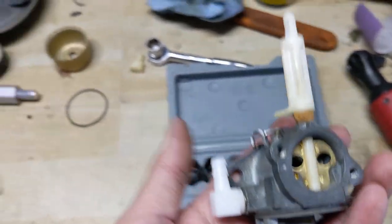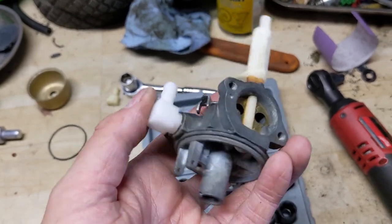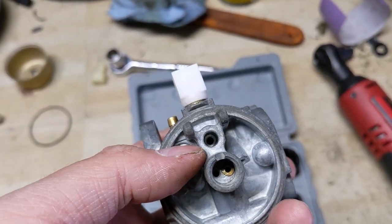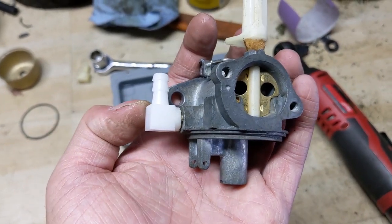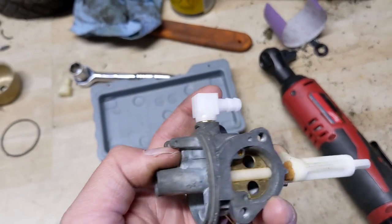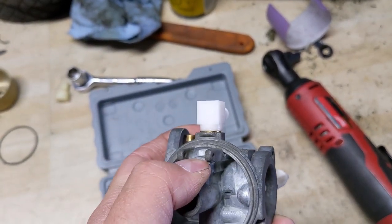Just like that, you have removed your old cracked leaky 90-degree fuel inlet and installed a brand new one. If you wanted to, you could go ahead and use your carburetor pressure tester hooked up the same way we did before and plug this hole. I don't have a new seat installed yet, so I can't install the float with the needle valve, since I'm waiting on a carb kit for this — but I did have this part, so I wanted to get that done.